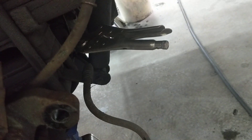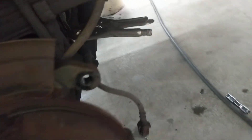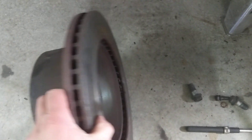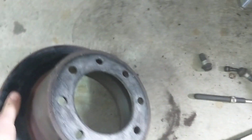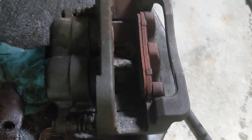When it gets that bad, you'll lose your brakes. You can see I have some vice grips on my brake line — I crimped the line just to get the truck home. And here's my rotor: you can see the inner part is much thinner than the outer part and it's chewed up because the pad material wore all the way through. The outside of the rotor is fine, nice and flat, because there's still pad left on that side.